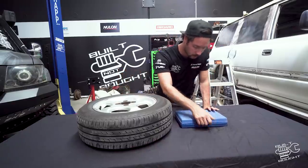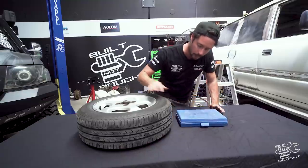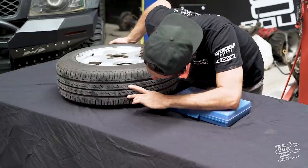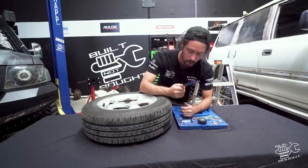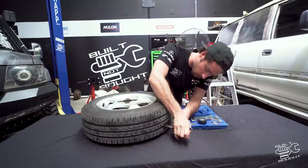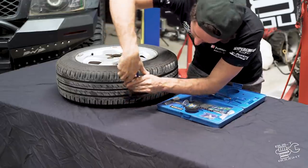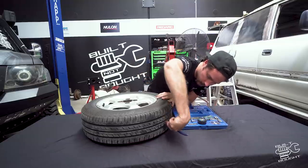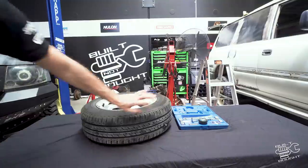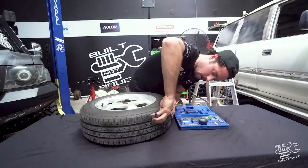Generally you'll get a little kit like this. This one's super old but most puncture repair kits for on the road look like this. The puncture is right here - there's a screw and that's where it's leaking from. First thing: get a pair of pliers and remove what's in there. You can do this with air in the tyre and you can do it while the tyre is still on the car, which is great. Just work it out so it starts backing out - it will come out with a pair of pliers. I can already hear it - there's a definite leak there.